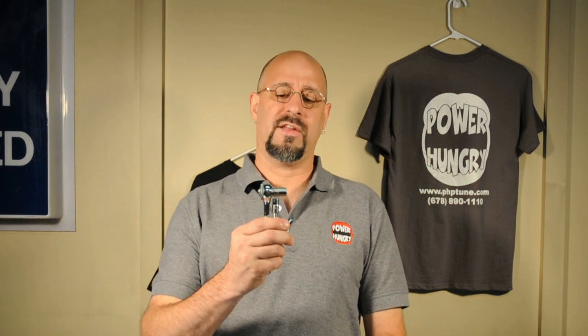To start with, you'll need a quarter inch ratchet with a 10mm, a 7mm, and a 5.5mm socket. You may also want to go to your local hardware store and buy a small brass toothbrush, although that isn't really necessary. The chip does come with a piece of Scotch-Brite, which is more than adequate for cleaning the connector on the ECM. So let's go ahead and get the computer out of the truck.